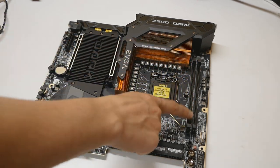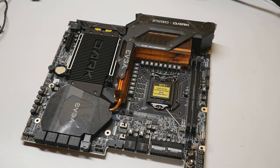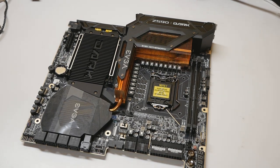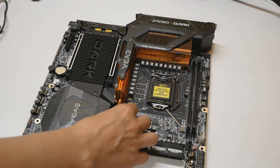I think this is the best-looking Dark board I've seen so far. Going through the main aspects quickly: we still have the 90-degree rotated CPU socket and two memory slots — one DIMM slot per channel — because that helps reach much higher clock speeds and tighter latencies for memory overclocking. Especially at the start with Samsung B-die memories, single slot per channel really helped a lot, though nowadays even four-slot boards have reached much higher clock speeds as well.